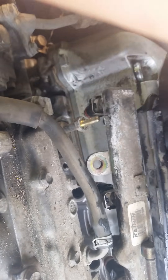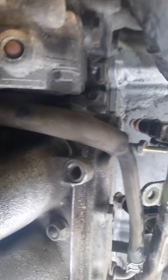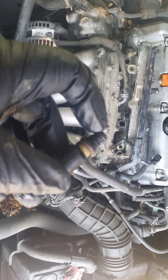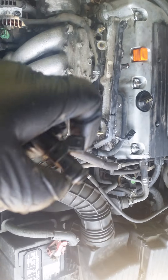You can always double-check them — I put a little pressure on the end of the fuel injector to make sure it was in there. There are three seals. Here's one of the old fuel injectors I pulled out. You can see it's pretty bad. You've got one seal on the very end, one at the seat right here, and then one where it goes into the top. As you're putting it in, this will go into the rail, and this is for your tab.